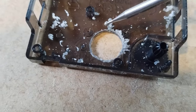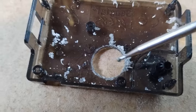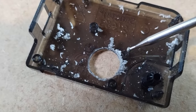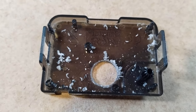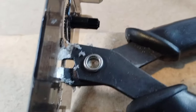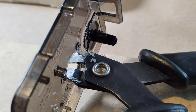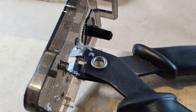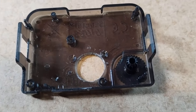Depending on the movement, sometimes you'll find that some of these other holes have melted a little bit or have been cut completely. You will want to take the end of your cutters or something else sharp to open the hole back up so that the gears can move freely inside. Next, cut the burrs from around this hole and clean out all of the plastic scraps. You can use the end of the cutters to pull out the burrs, or scissors to ream out the hole. It does not have to be perfect, but if any plastic pieces were to fall off, they could clog up the movement. When done, it should look something like this — nice and clean.